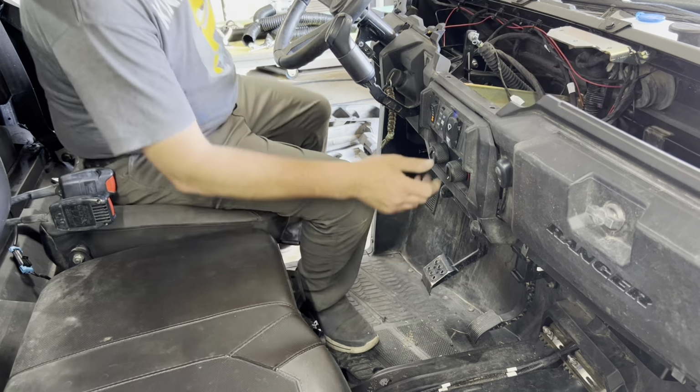Now let's run it and cycle it until the fan comes on a couple times. Check for heat, yeah, I got heat coming down the manifold. Okay, so I think we're gonna hit 203, 204. 204, the fan comes on. We'll be there just momentarily.